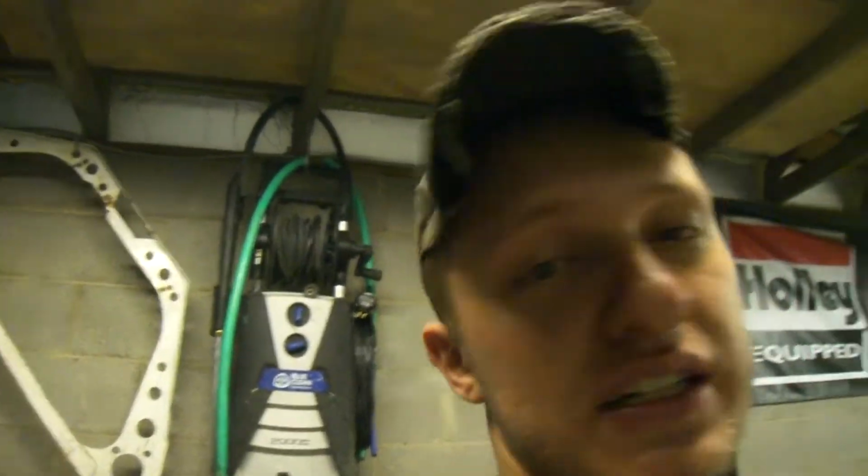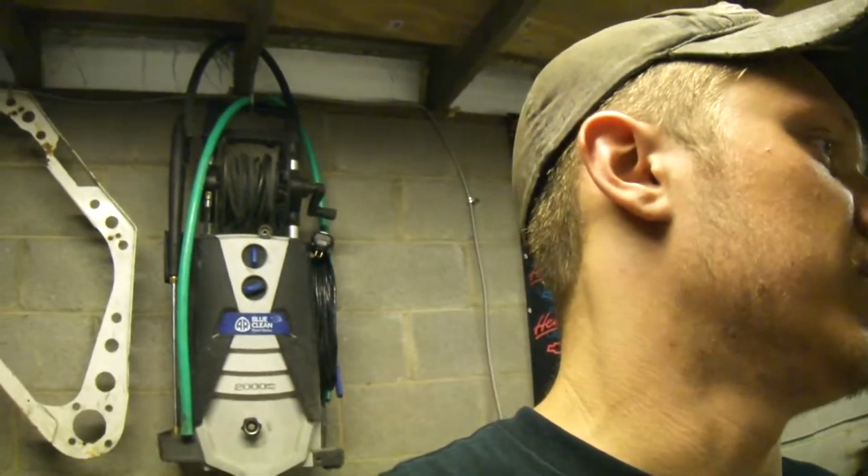That one's not. I did try to hot start it real quick, and it almost lit off, and then I was pumping the throttle too much, and I definitely just flooded it. But as neither here nor there, my camera battery was dead, so I didn't get to film it. But that's on me again. So I'm gonna let this sit here, cool off a little bit. I need to zip tie that fuel pump up out of the way.